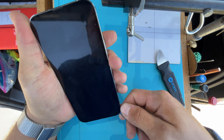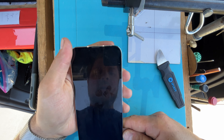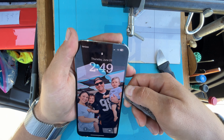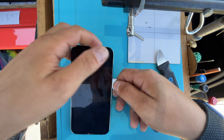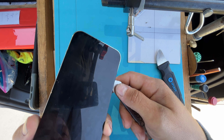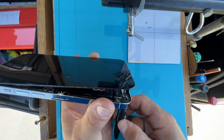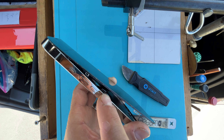So I will prop open the screen with my finger and drip some alcohol into the other corner, and that just slots in pretty easy. Now your OLED flex is right about here — I'll point this out in just a sec. The technique I use to avoid a cutting motion is important because your battery is right under here — you don't want to accidentally damage something. So I have a sort of turning motion rather than a cutting motion. You don't want the phone open more than about that much — once again, our screen flex you can see is right there.